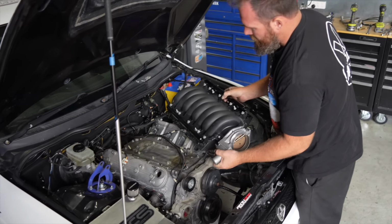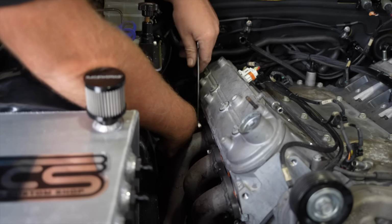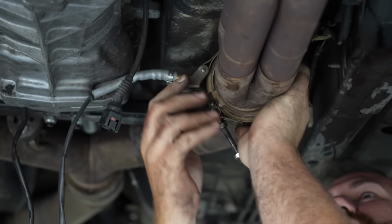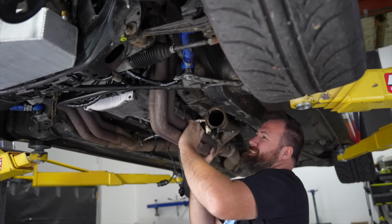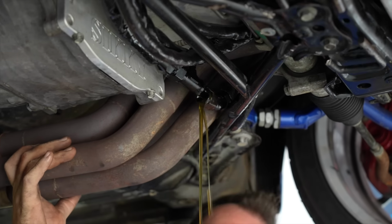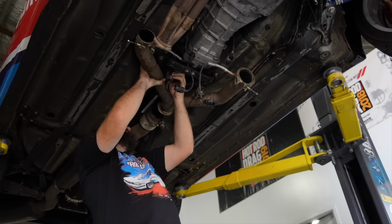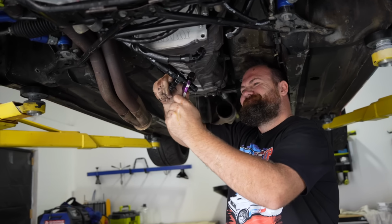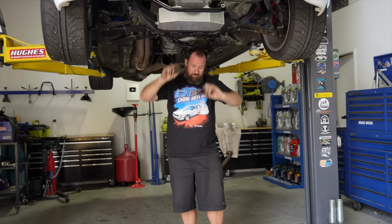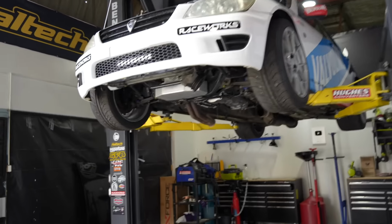My least favorite design element of the LS is that you can't change the lifters without pulling the heads off. Nailed it. Once that piece can come off, I'll put plugs in the lines and caps on the sump as soon as I go and delve into the box of goodness.